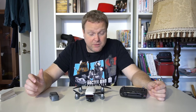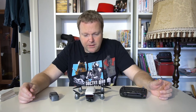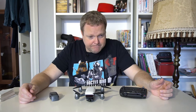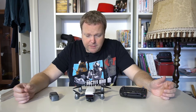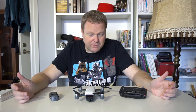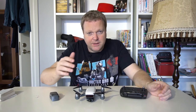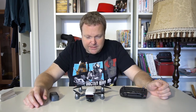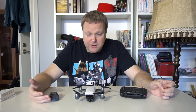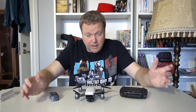That is by far the most obnoxious setup process I have ever experienced — DJI clearly has some work to do on ease of use. For the first flight I went to a field not far from my house. There was some confusion before I got flight-ready — I stupidly brought a white metal thing to put the Spark on so it didn't sit on the grass, but that confused the compass because of the magnetic surface, so I had to move around before everything settled.